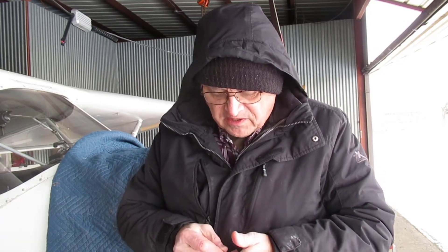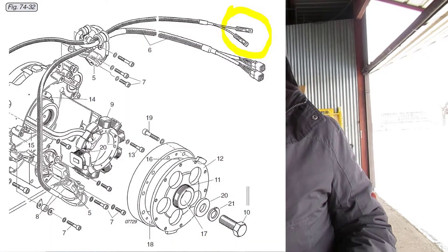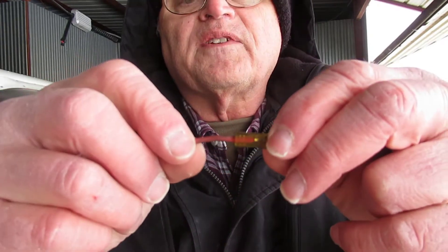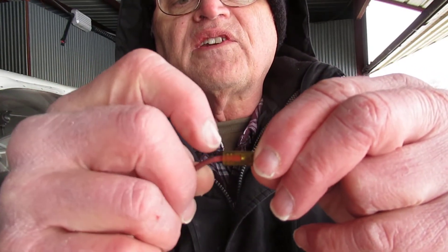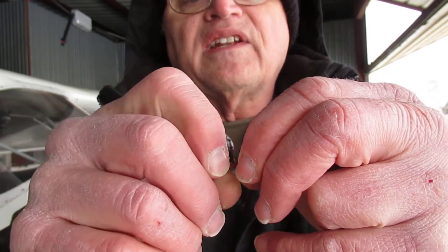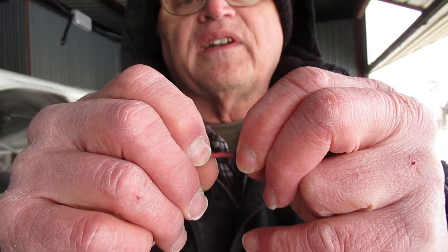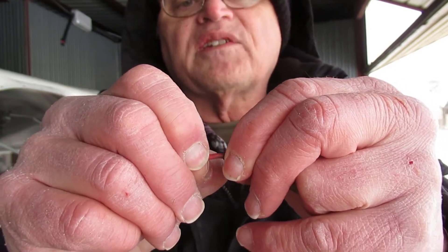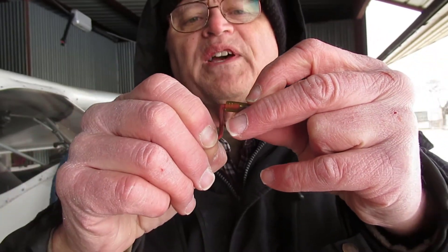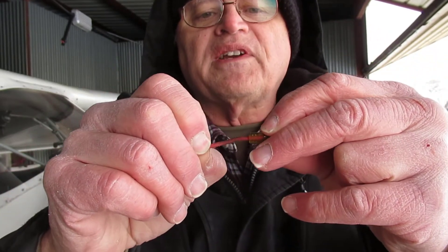As I'm looking, I notice one wire here — one of the wires connected to the charging coil that provides power to the capacitive discharge. As I kind of poked at it, you can see it stretching right here. The wire inside there is broken, and it's solid through here, but out here it's broken at this end too. So this wire is actually broken in two places. And yeah, there's my smoking gun.